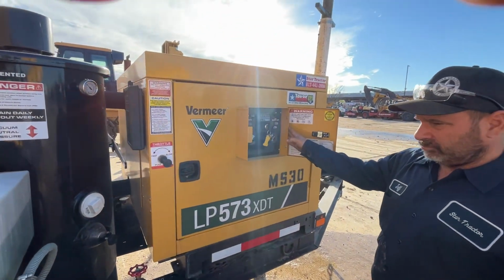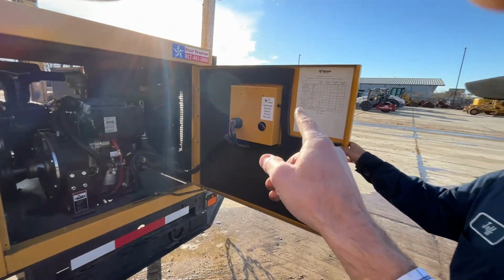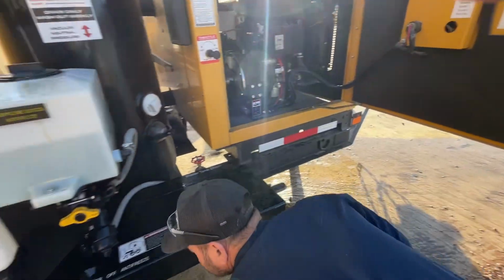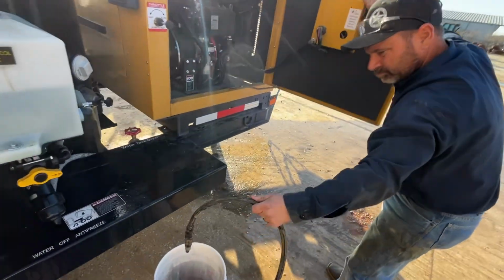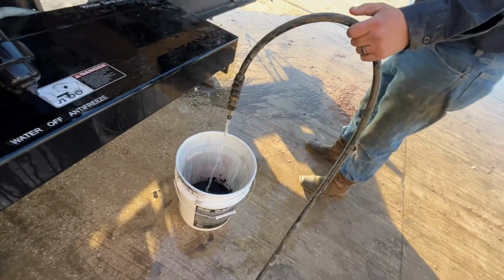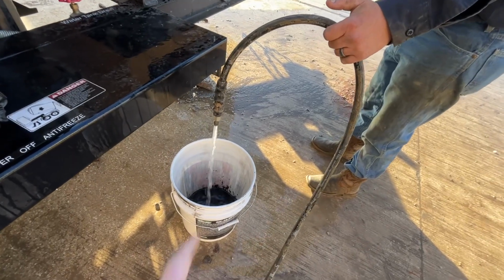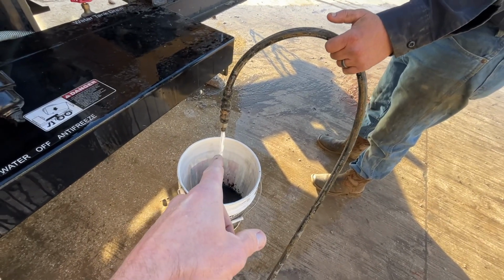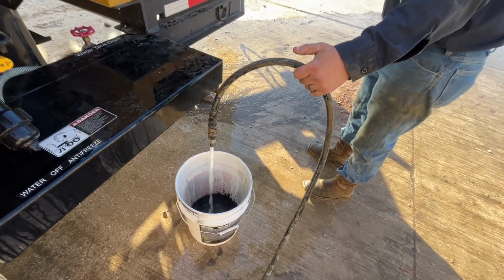So you'll see Jeff tried to turn on the pump, nothing coming out. So we're gonna hit this bypass switch, we're gonna hold it. Let Jeff get resituated. Okay, now you see as soon as he clicked that bypass switch, it engages that pump. Now let's watch, it's clear, it's still water. As soon as it turns green, we're gonna know we've got antifreeze through the whole system.